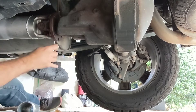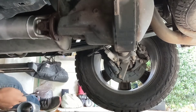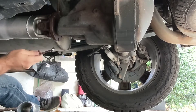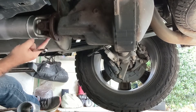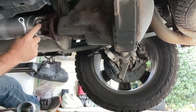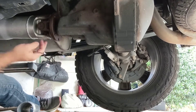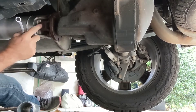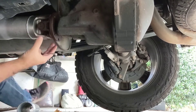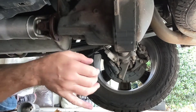And that is all you need to do. Then you rotate it where you can get to the other bolts, and those will come right out. Sometimes people heat them with propane torches to loosen up the thread locker. I also put a little bit of penetrating oil — PB Blaster — on all of these joints last night just to kind of prep them so they'll be easy to take out. But once you take this off, we're going to drop the driveshaft down and slide it out of the back of the transfer case.